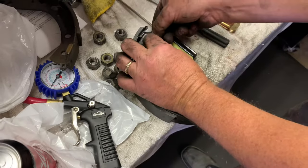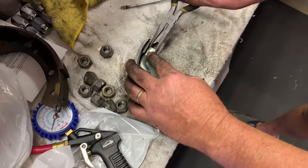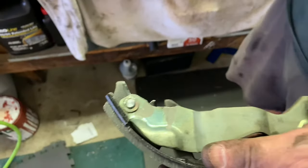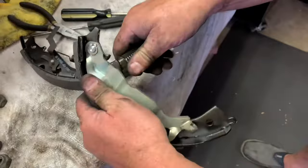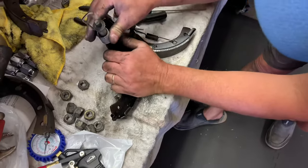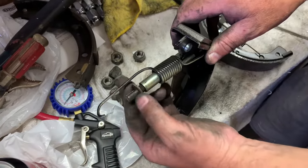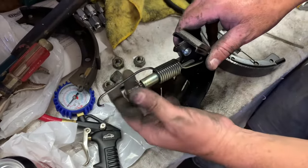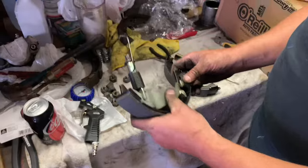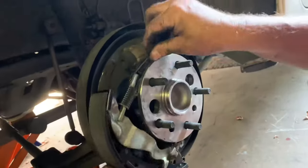We'll take this and go to the new one. Put it on there and get a needle nose pliers. There we go. Now screw this in so that — because you have more brake pad on there — it goes behind the drum. And then will that auto-adjust eventually? I think so, yes. There we go — that just loops in there from the side.